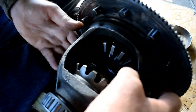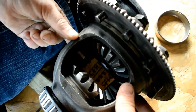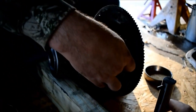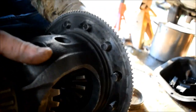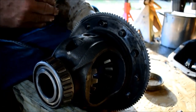Okay, here we go. Now, check out the side. Now, I think we're off a tooth. Otherwise, the pin wouldn't line up. The pin would line up if it was correct, but I don't think the pin lines up. Because one hole's cockeyed and the other one's straight. Why don't you take a look through? I see. That gear's a little bit up. This one is lined up perfectly, but that one's up. Let's take a look. Look, we're off. Oh, yeah, never mind. I do see. We're off also on the bottom, so everything is shifted this way.